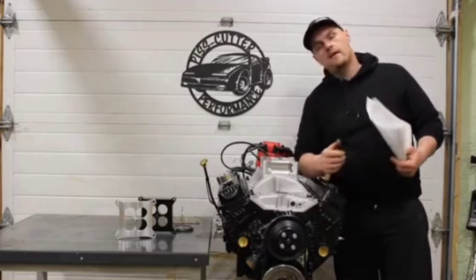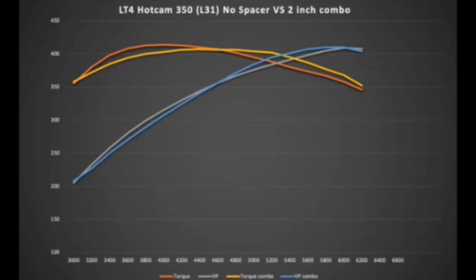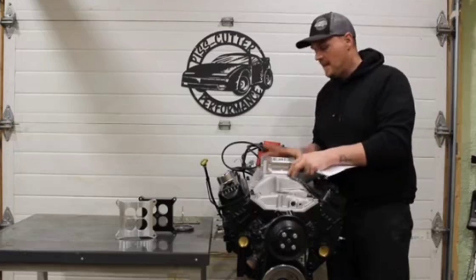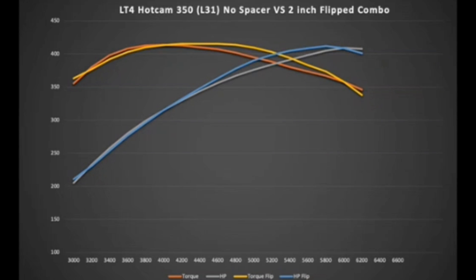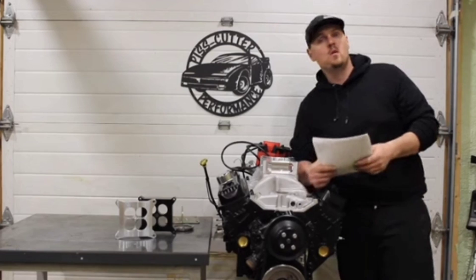So let's throw the tapered combo spacers on there and see what kind of results we've got. Just when I thought the tapered combo was going to be the one, to my surprise, it did almost exactly the same thing as the open spacer, except it picked up a little bit more torque at the top end. So I went out to the dyno and decided to try flipping the tapered combo, so it has this radius sort of thing going down into the dual-plane intake. Let's see what kind of results that gives.